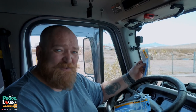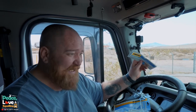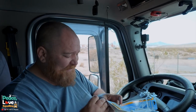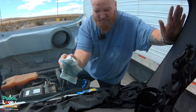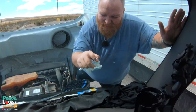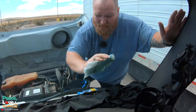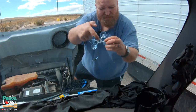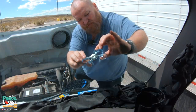After you peel off the curing strip, you scrape away any excess. It's a real simple basic kit. The resin - you can get a couple applications out of this, it's not just for one crack. There's enough resin to repair a couple cracks. So, ten bucks, quick kit, easy to do. First, to clean the surface, you want to make sure you get any little tiny pieces of glass debris out of there. Use the razor blade maybe, but I'm going to wipe this down really good. We got a little hole right here - we want to line that up to the center of the crack.